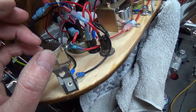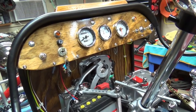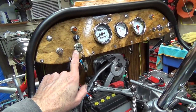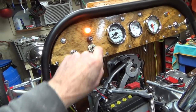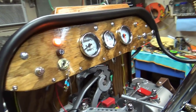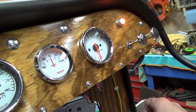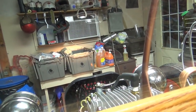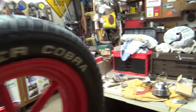Once it's bolted in place it's no problem because the body is grounded. Here we go for our shaky cam. The first thing you'll notice is we have a fuse right here, so all my power goes through the fuse before it goes to the ignition switch and before it goes anywhere else. When I turn the key on, this light here lights up, and there's another light over there that isn't lit up yet — until I turn my lights on, and that stays on for both headlights and taillights.